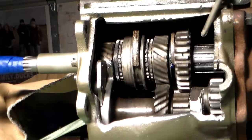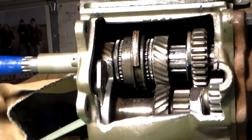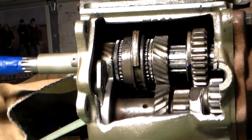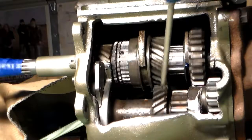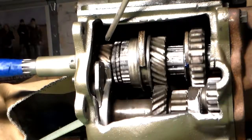Now we're going to go from first gear to second gear. First gear has got to come out as the shifter lever moves. Notice that the main shaft stops rotating. Now we move over and go into second gear. This locks it together — the second gear is now locked to this gear, which in turn is locked to this gear all the way through. So we now have constant flow. Notice however that the main gear and the main shaft are still not rotating at the same speed.